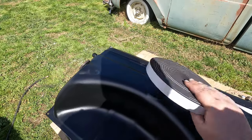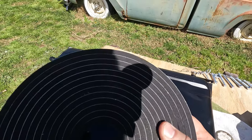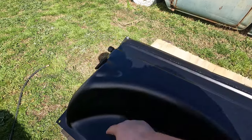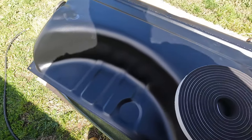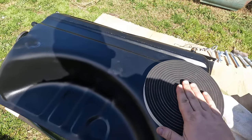Next job on the tank is before we mount it, where it touches the body. This is an adhesive waterproof neoprene foam. We're going to run a strip along here, one along here, maybe just a couple of little pads down in the wheel well, and we'll run a strip along the strap as well — just to sort of isolate-mount the tank.